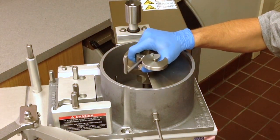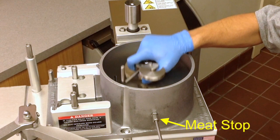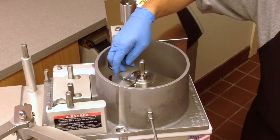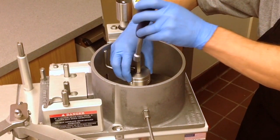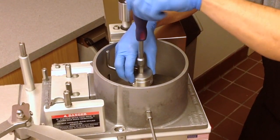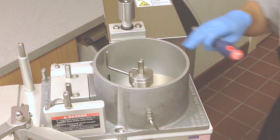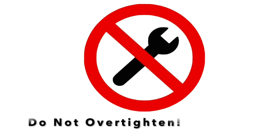Place the feeder over the shaft. Be sure the retractable meat stop is out of the hopper so the feeder can go all the way onto the shaft. Twist the feeder washer until it is under the hold-down bolt and tighten the bolt with the tool provided. Do not over-tighten or use any other tool.